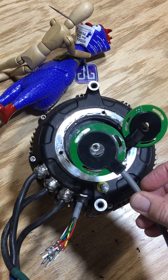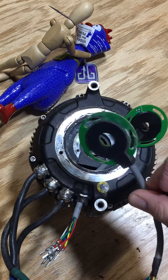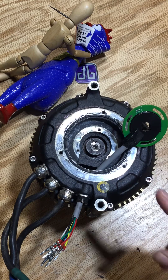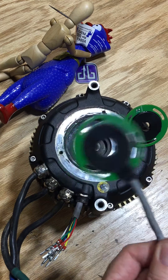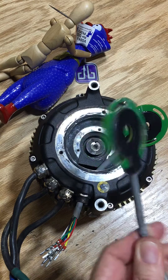Today we're going to talk about the Suron and the Segway Hall Effect Sensor. I had a motor that was cutting out at startup — real jerky, and sometimes it would bang or stop moving altogether. Something was definitely wrong, which typically is the Hall Effect Sensor. And sometimes even when you're going half throttle or a little more, it'll just shut off and not go anywhere. That could also be your Hall Effect Sensor.